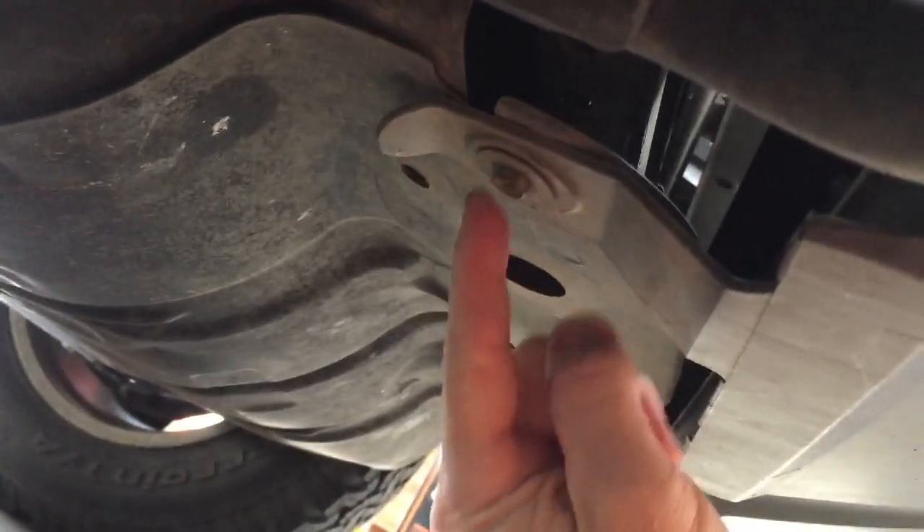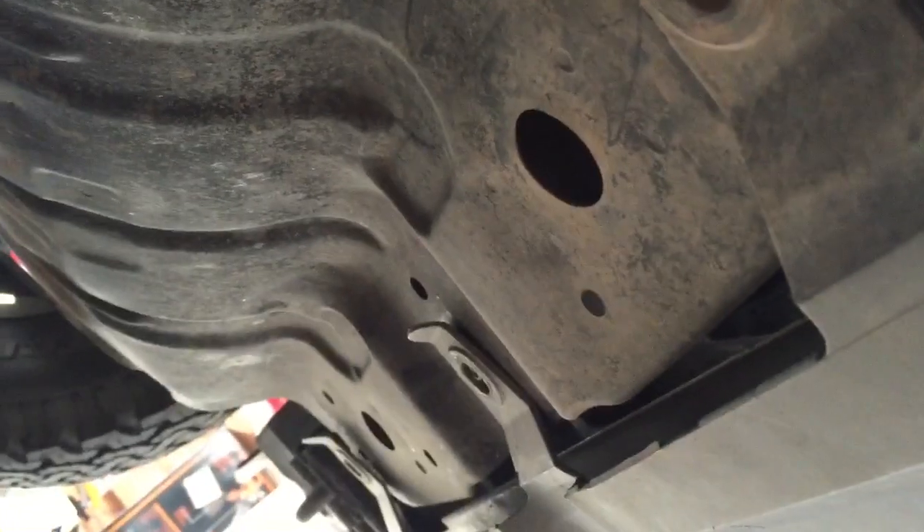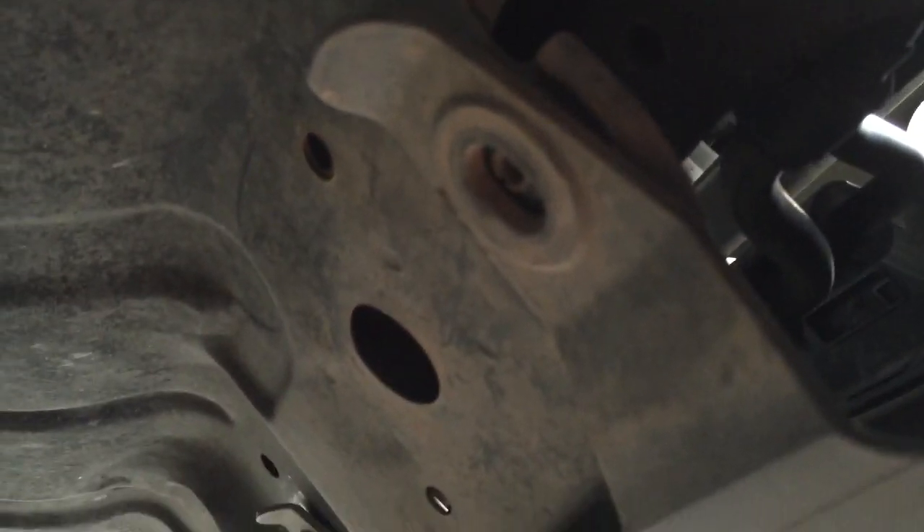The first thing I'm going to do is remove this skid plate in order to get to that tensioner arm. As you can see here, there's the bolt here. We've got to remove three of these. I've already removed two of them. We've got to get to the third one here — that's step one. Those are 10 millimeter or Phillips head to remove those.